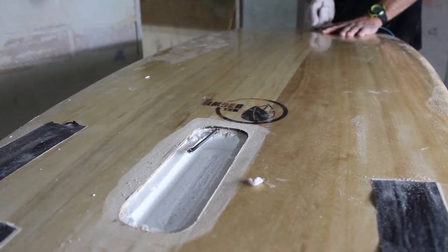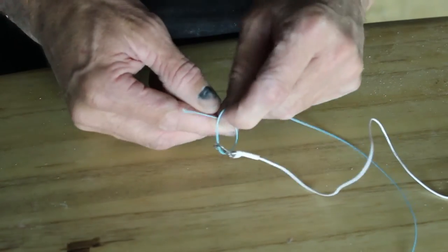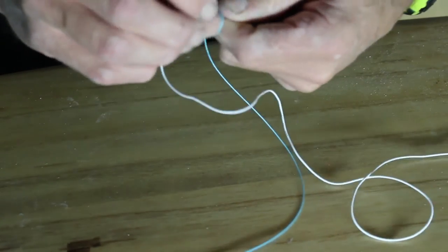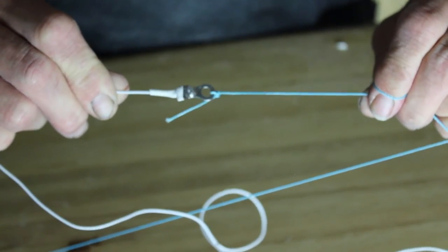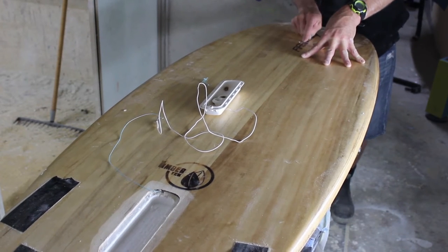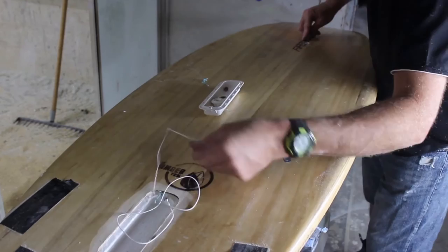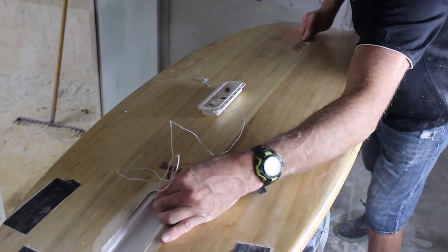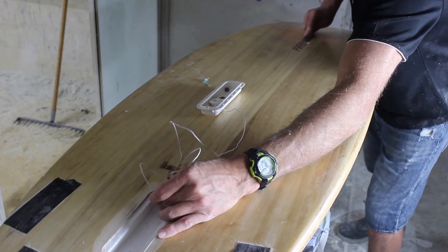Slowly and carefully feed the metal rod through the board until it reaches the housing. Once the wire has come through to the housing, attach at least one metre of braided fishing line to the end of the hook, and then also attach the eye of the repeller cable to the braided fishing line. Then pull it back through the board to the front plug. When drawing the cable through, make sure you do it very slowly and don't yank the cable, to minimise the chance of breaking the draw wire.